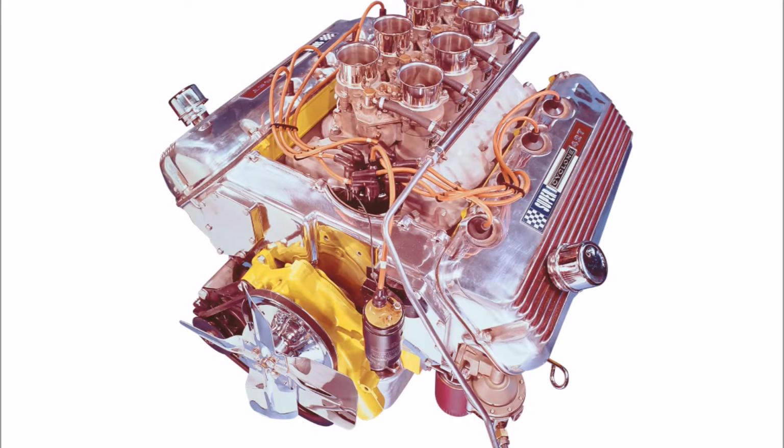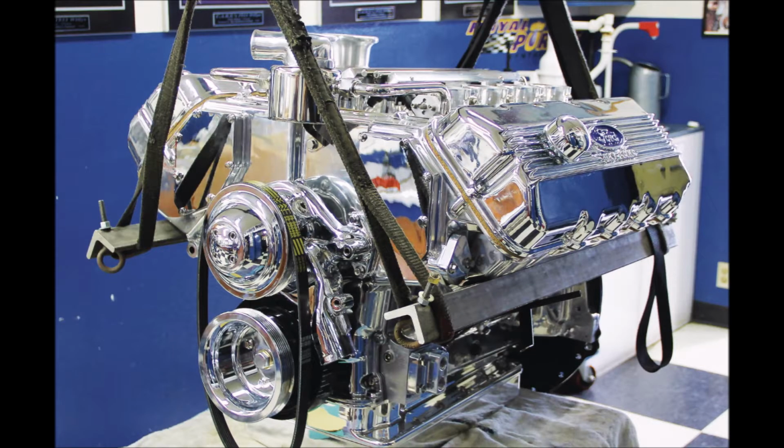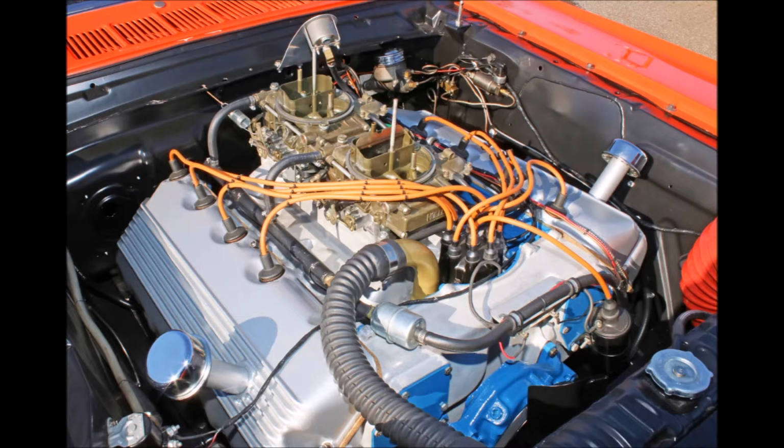The engine was a 2-valve single overhead cam conversion of Ford's 427 cubic inch FE V8, nicknamed the Cammer. The heads were predominantly cast iron, but aluminum heads were later available. It used a roller cam drive with a 6-foot timing chain. The heads featured fully machined combustion chambers, stainless steel intake, and sodium-filled exhaust valves fitted with inner and outer springs, operated by shaft-mounted roller rockers. The lower end featured revised oiling and cross-bolted main bearing caps. The block's cam bore now featured an idler gear shaft that spun the distributor and oil pump.